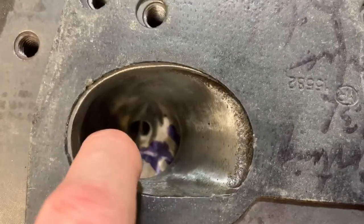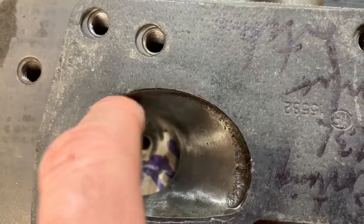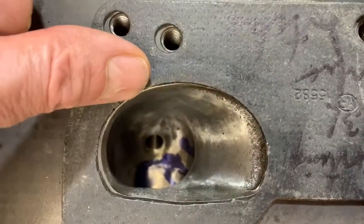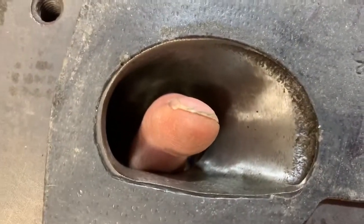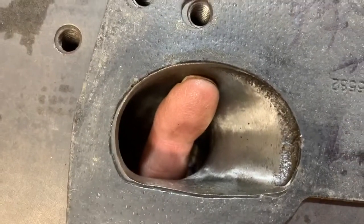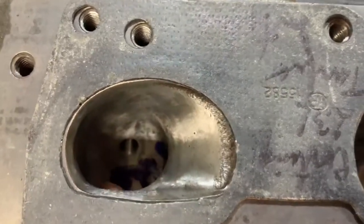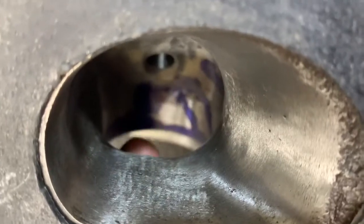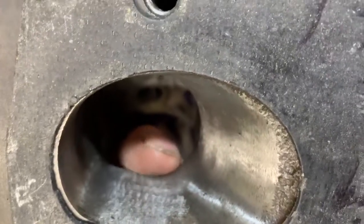What you're trying to do in general is stay off the floor — just level off the floor — open it up on the walls, and try to open it up as much as possible on the roof. You're trying to raise the roof, and you want to do this on the exhaust side as well, because the idea is you're trying to decrease the angle of this corner. Instead of a sharp turn, you want it to have less of a turn — as straight as possible is going to flow the best. Then you just want to round out the bottom and make a nice gentle radius, because if it's an uneven radius the air just can't flow evenly.